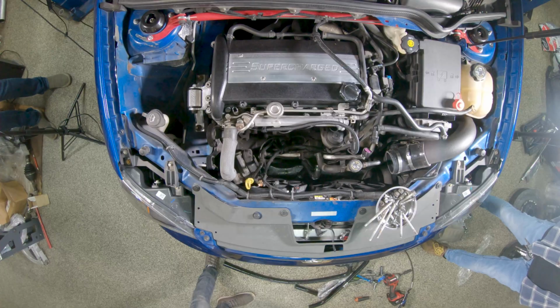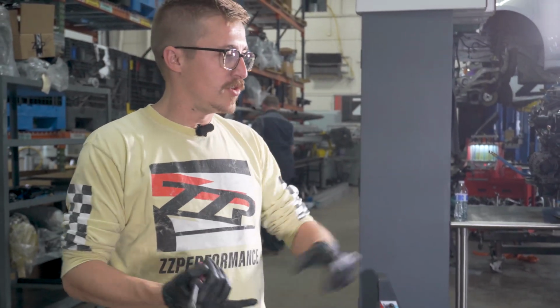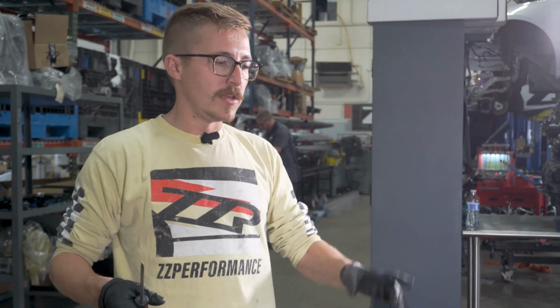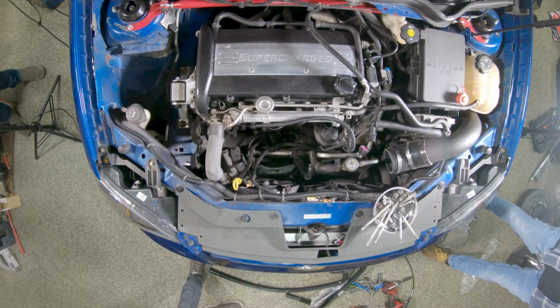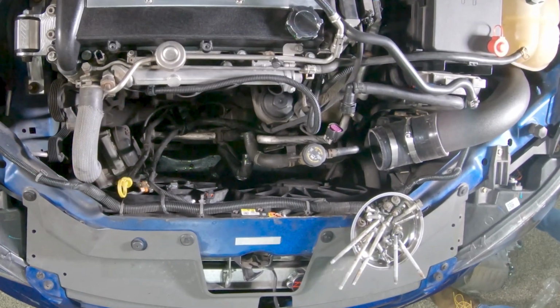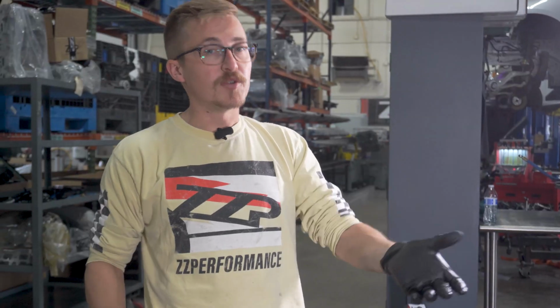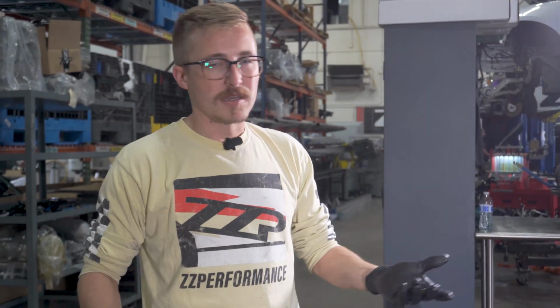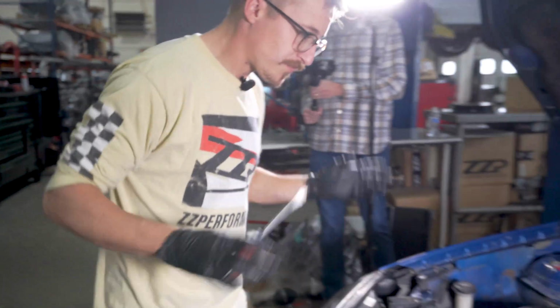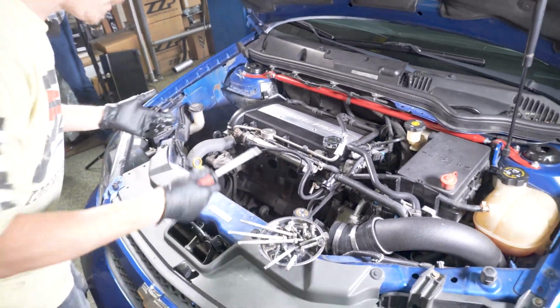Okay, I'm ready to get our silicone hoses in, get our option B plumbed and installed, and then get the manifold back in. So now, 2 things. One, if you're doing the option B at the same time, you no longer need your fill neck over on this side. The option B is now going to become your overflow tank, and that's where it's going to bleed from. So you don't need this any longer. I suppose you could reuse the T if you wanted to, but it's kind of unnecessary at this point. Routing is going to change over the stock routing because we now have the dual pass.